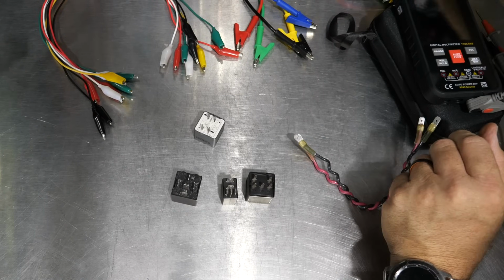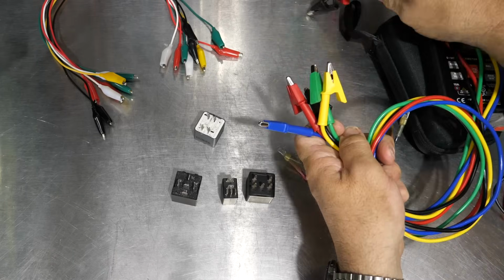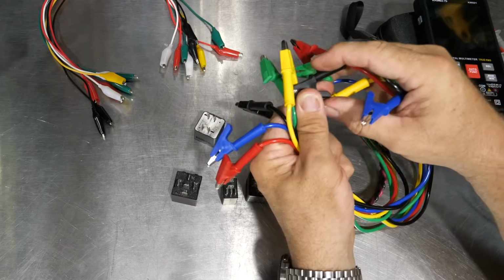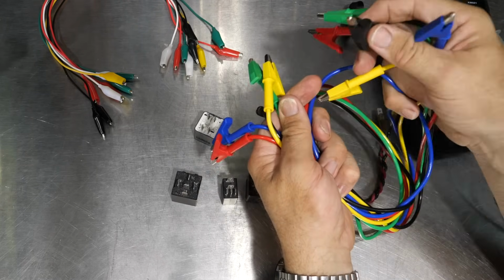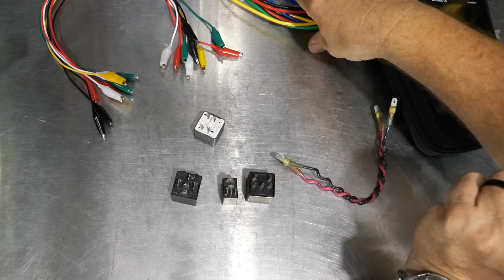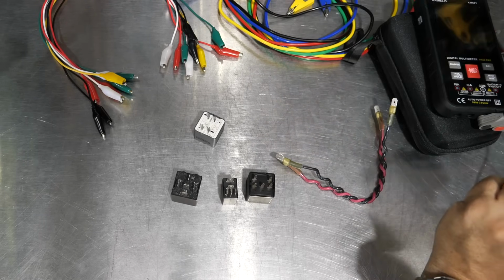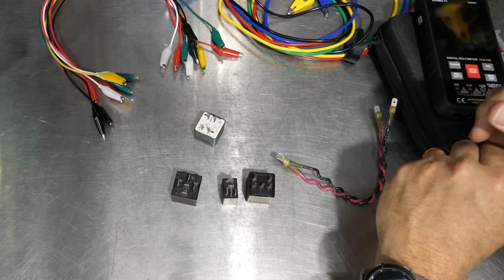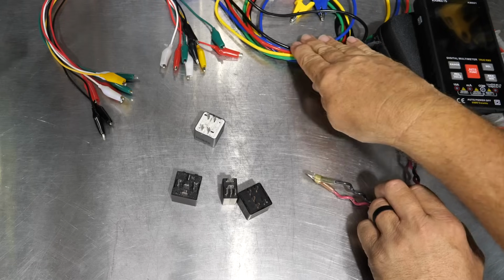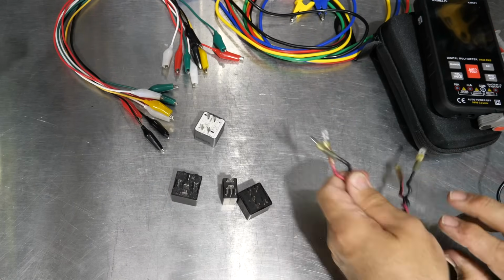And then if you do this a lot, or you like to power stuff with your wire leads, then you can get a little bigger set like this. These come in really handy. A little more powerful alligator clips on here, and they will handle up to 10 amps. So again, I can actually power stuff with these, not just test whether we're getting 12 volts to something. I can actually power up a starter motor or something like that. Now, you don't want to put a load on it with something like this, but still, you could actually run the power to it, spin the motor, whatever you're trying to do with this heavier gauge. And I think those are like $12. So a little bit more, but still, these are very handy to have. Definitely this kit here. And again, at $6, why not?